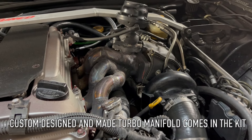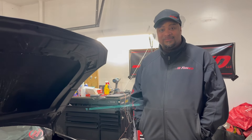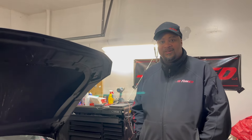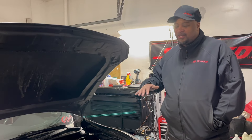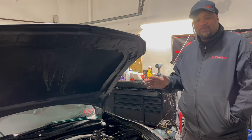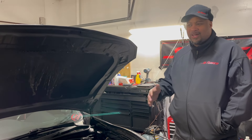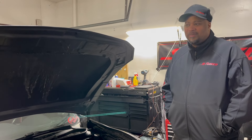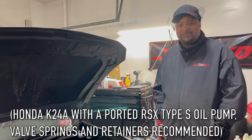It's an OEM Evo 10 turbo with upgraded impeller wheels. The Toyota ECU does have a very low redline — what's the safe redline in your opinion? The OEM redline is about 6,300 to 6,500. These heads have been known to take up to about 7,000 RPM before you actually have to upgrade the valve train. Once you upgrade the valve train to something like Supertech — valve stems, retainers and all that — you can redline at about 8,300. That's the same safe territory for the K24 if you do a couple of simple mods.